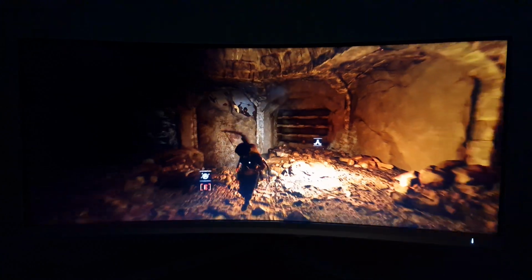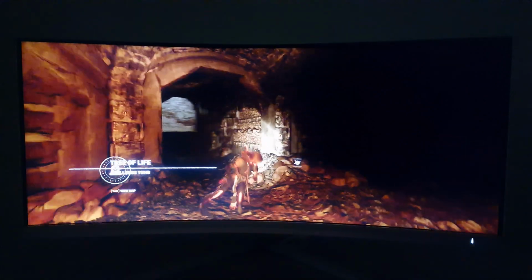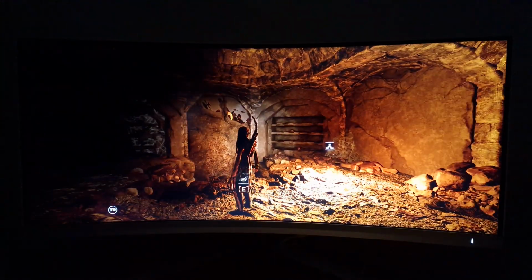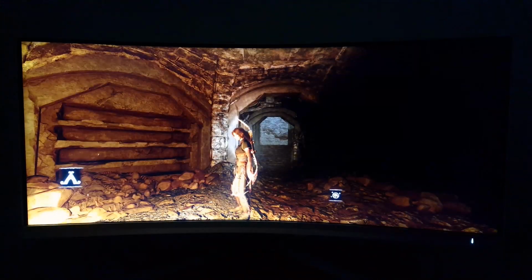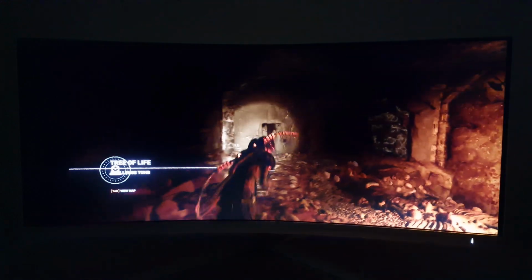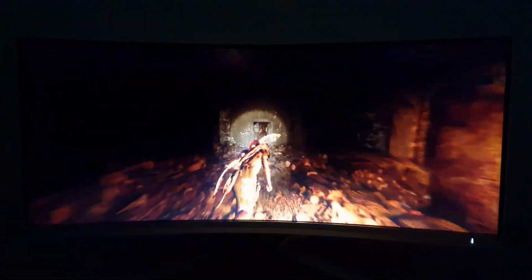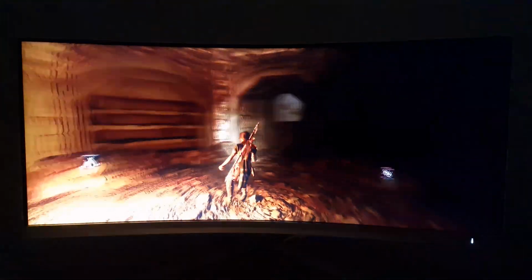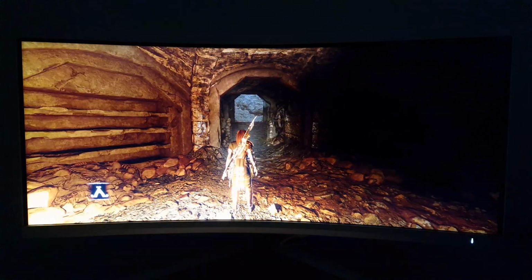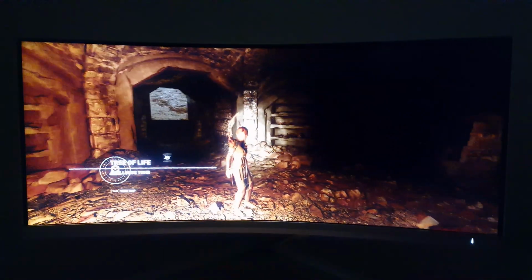And whilst I'm talking about the ViewSonic, it's worth mentioning that you could use local dimming under SDR on the ViewSonic, whereas that is not an option on this Philips monitor. I didn't love the local dimming under SDR on the ViewSonic because it had a very high locked brightness, which just doesn't work well for SDR. It really uplifted medium shades far too much and made some things look far too flooded. Really not as they should look. You don't get the same kind of tone mapping precision as you do under HDR, so it didn't work very well at all. But it was at least an option. And I have mentioned this to Philips already, and they've said they are exploring it as a possibility for future firmware, but no promises that they'll add that.